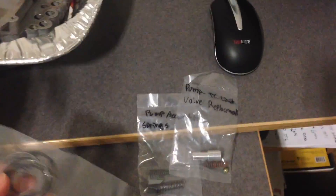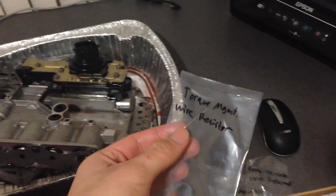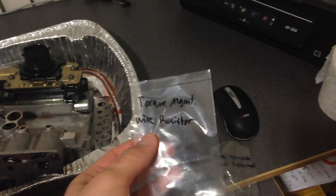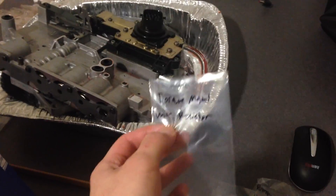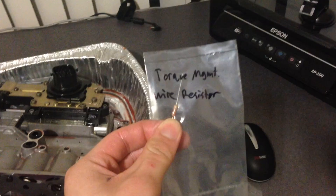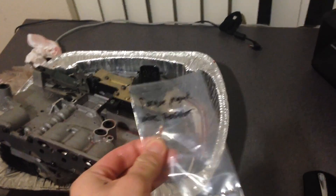Also in the kit you will get new seals for the accumulators — there should be five. In the kit you will notice that you get a resistor. If you have a Superchips or SCT tuner, don't bother installing this resistor. But if you don't, installing this resistor will firm up the shifts and make the transmission shift more firmly.